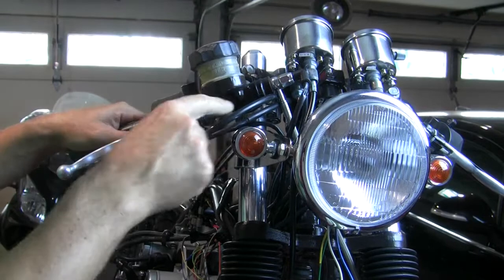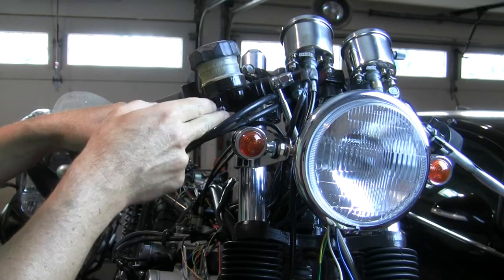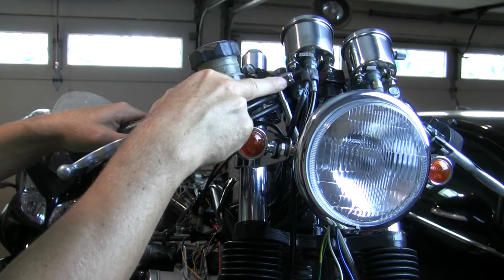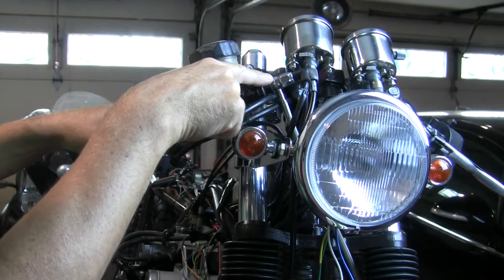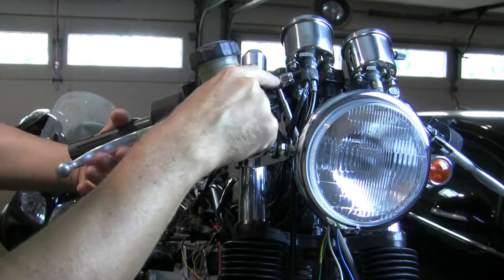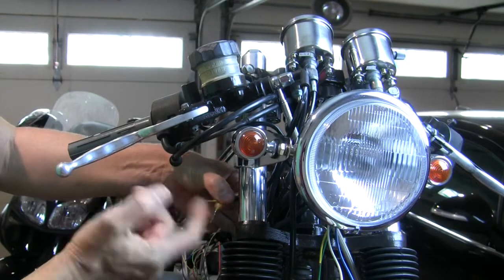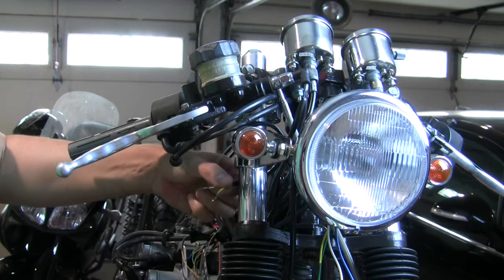In my particular case, the original brake switch is broken and unrepairable. So what I've opted to do, because I'm going with the stock master cylinder, is to use one of these pressure switches that essentially replaces the banjo bolt on the hydraulic brake line. You put this switch in — it is a bolt and the fluid flows through it — and then when you pull the lever and the pressure increases, it flips the switch inside. I've got two wires coming down from that; they are just two yellow leads. Polarity doesn't matter here — a closed circuit is a closed circuit and an open is an open, and it doesn't matter what direction through this switch.